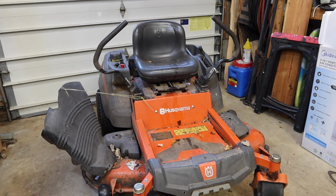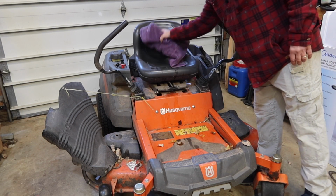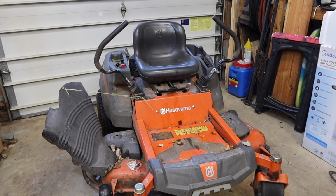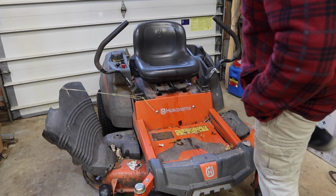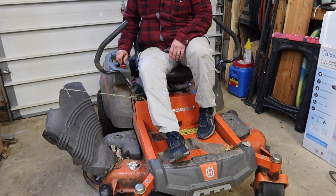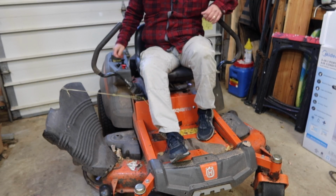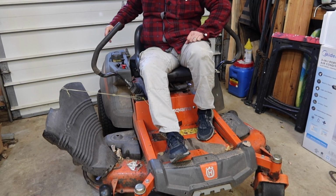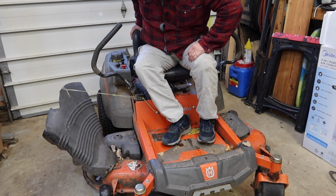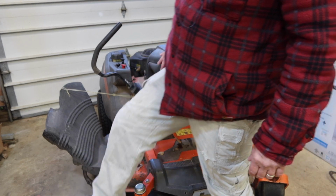They parked it. When I went to turn the key the next time, it just gets a chunk noise. Fairly confident we're looking at an electrical problem. Battery could be dead now, but let's just take a quick peek. Chokes out. Safety levers are off. I don't even have a chunk or anything right now. Let's put a jump pack on the battery and see what changes.